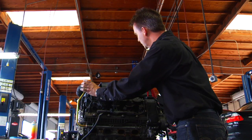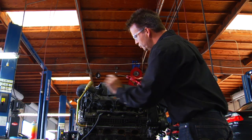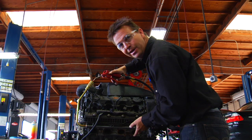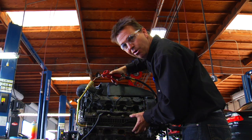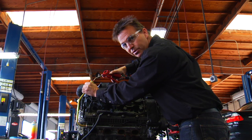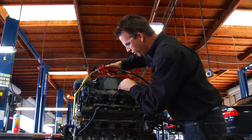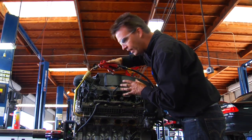On the next step, remove the funnel. Very important: put on safety glasses because you will get some spray back. Use a rubber-tip air blower with compressed air and blow into the engine. Usually you'll hear a pop from some of the galleys clearing up and you'll see debris coming out — in the car you'll just hear air starting to flow through. Hold the tube into the galley with your hand because it's sealed with the O-ring. You can also hear when on the air which cylinder's exhaust valve is opening.